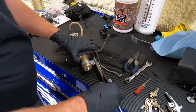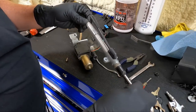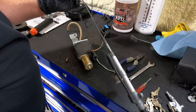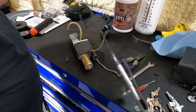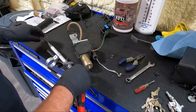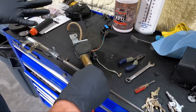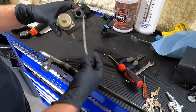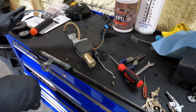I was hoping we could pull it out, but see — the mast is broken further down than we thought. If it's broken off you're not going to be able to thread that piece out, and you can see where it's broken — there's still a piece in there. I don't want to leave that piece in and try to thread the new one in and then snap it off. We're going to have to do a little more work. I may have to drill out the factory rivets and grab that extra piece out — that's what I'm afraid of.